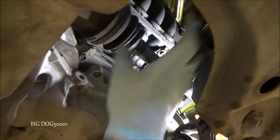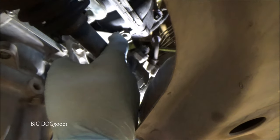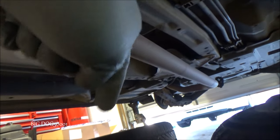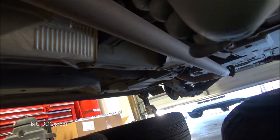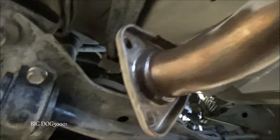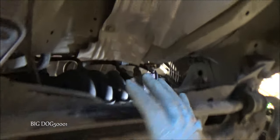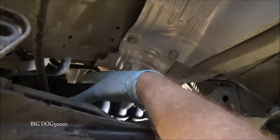With the A-pipe out, we have a little more room. Next, Honda recommends we remove the bracket on the intake — there are two bolts on it and one bolt below. I popped it off the rubber hanger and tied the pipe off. You can see from the subframe that the pipe was right here; now we have plenty of room to reach in.